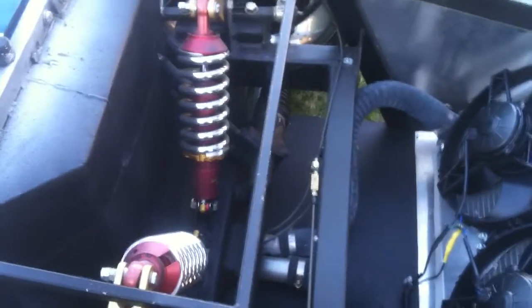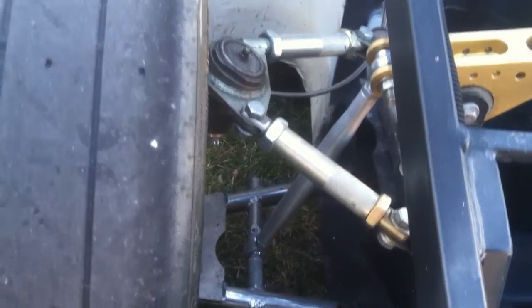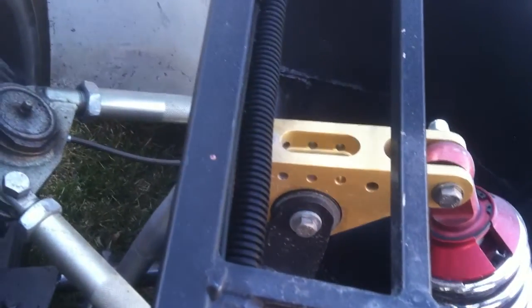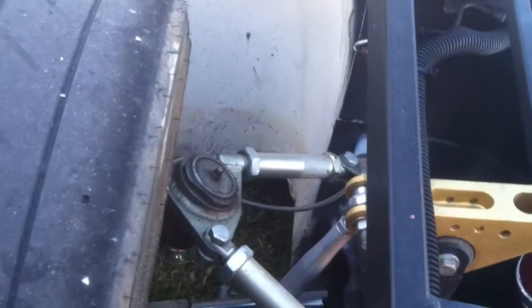You can see the cooling tubes — they run down through the center tunnel. The front suspension is based on a Mustang II, except we use pushrods with a rocker arm setup that we got from Shelby Motorsports in Las Vegas, with the coilover springs mounted inboard. Kind of race car style. Fully adjustable — caster, camber, toe, and ride height with the coilovers. Uses a forward rack and pinion steering unit.